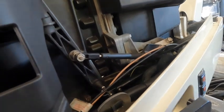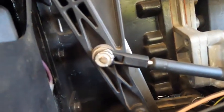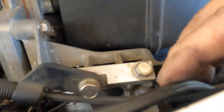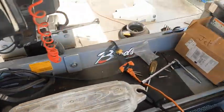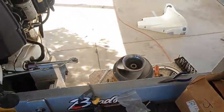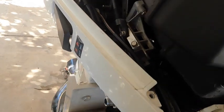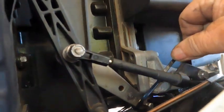Now I need to take these cables off of here and here, run them out. There's a little keeper here and a little keeper here - you've got to take this little keeper off, get that cable loose and get that up out of there. You're not going to need that keeper for the jet cable because it hooks directly up inside. You've got to zip tie that up there so it won't flop around on you and you won't be able to start it sometimes - zip tie it up like this, that'll hold it up so it won't flop around.